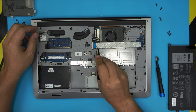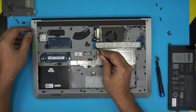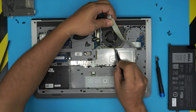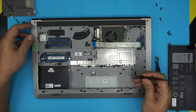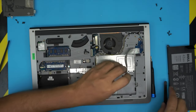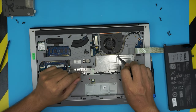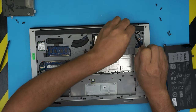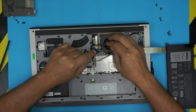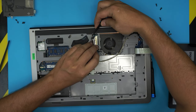Next, remove the bridge cable that connects this board to the main board. Lift up this plastic flap 90 degrees from one side and slide out the ribbon cable. There's a little adhesive tape — just pull it up slowly, don't bend it. Also go ahead and remove the flex cable and the LCD cable — just untangle it, run it across, and lift it up. Push this side backward evenly and remove it.